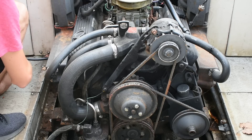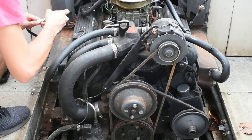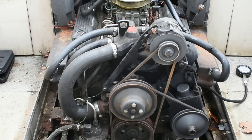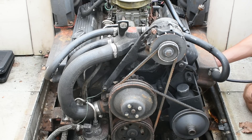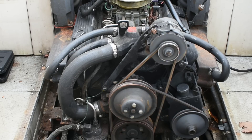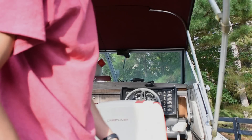Take three, see how we end up. Yeah, it's 120 pounds there. Last one — a little better at 130 pounds. Let's try the other side: 60 pounds, not great. 30 pounds again. 120, right at that. I'm not going to lie, that compression test was a little bit upsetting to say the least. I've only got two cylinders — well four I guess — that have good compression. The other two are just 60s and 30s. It's not great, needless to say.